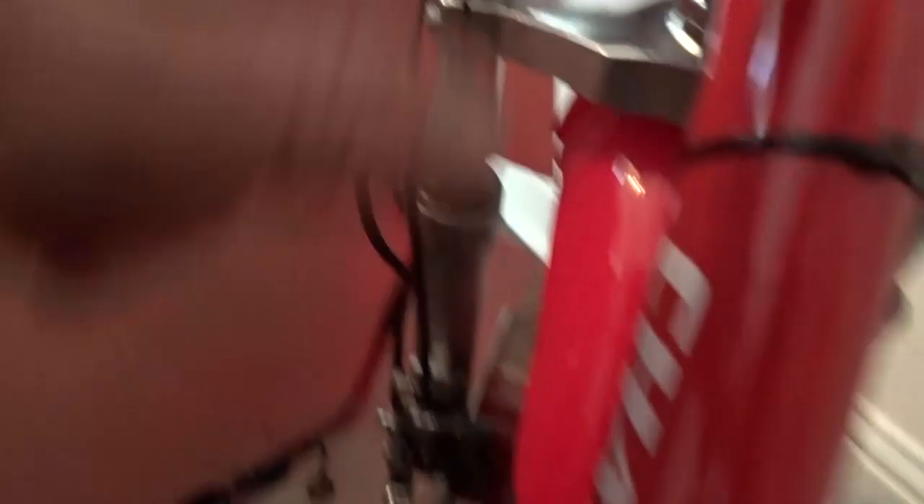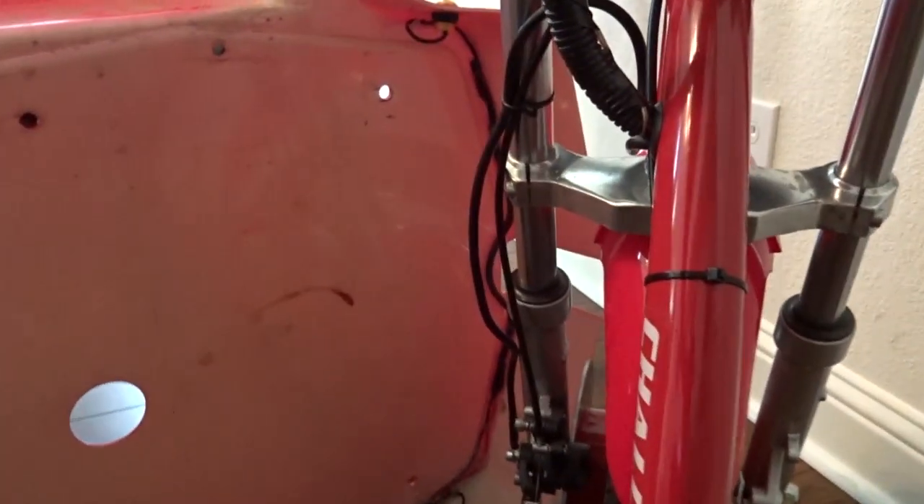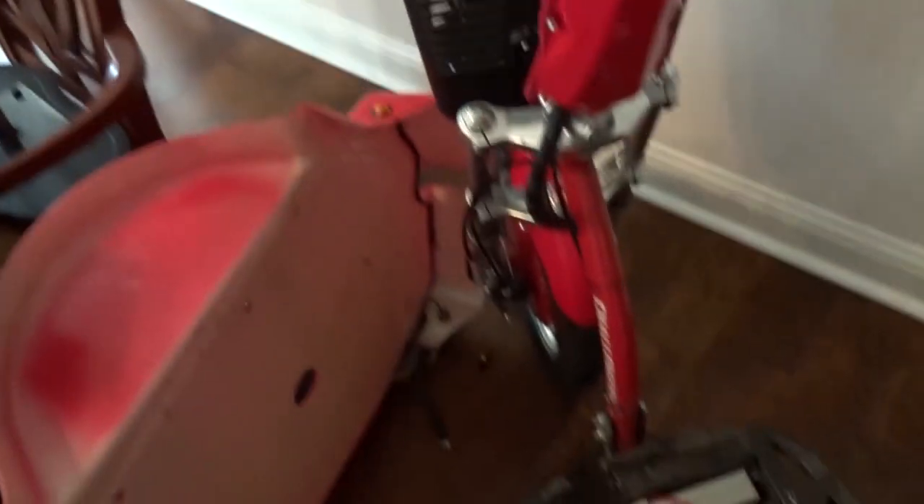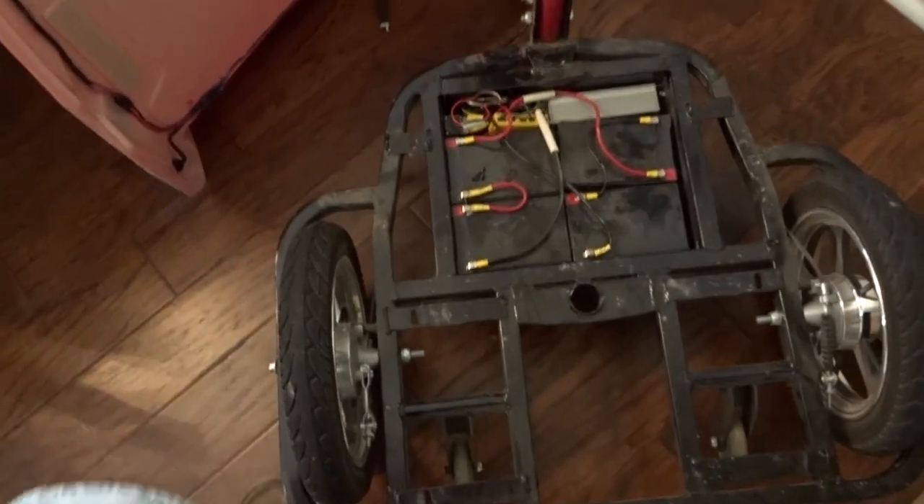The wire for the lights — I was unable to get it inside the little plastic harness, so I used good quality Scotch 33 electrician's tape and routed the wire down through the metal housing and up through the plastic shroud. You can see it is firmly taped in place and connected to the switch inside the headlight switch assembly.